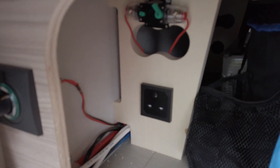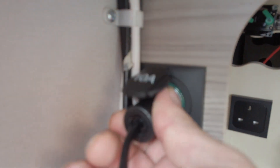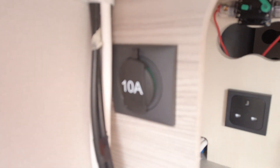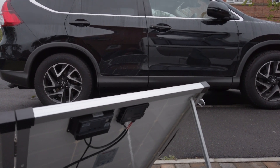As you can see, the front locker has a cut-out for using a plug socket. There are two holes cut just above, and one cut here, so I've used that to plug in a 10-amp cigarette lighter socket. Using 1.5mm cable, and just above you can see I've fitted a circuit breaker fuse, so that should the charge controller go wrong, it will protect the caravan.